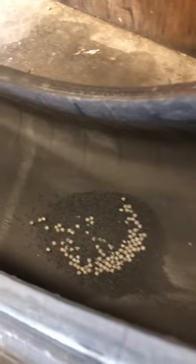If you look down in the tire you can see all that black dust — that's all the inside of your tire membrane. All of that area that looks sanded smooth, where you don't see those lines on the side, that is sanded smooth because of the beads. The beads actually sandblast the inside of your tire. That's why you'll never see us use beads on a motorcycle tire here at CycleStop.